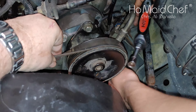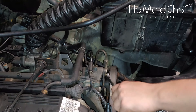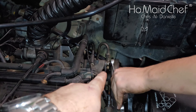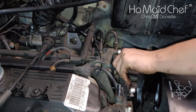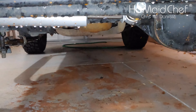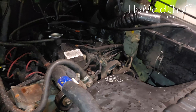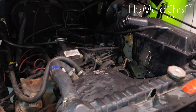We can always tighten it some more if it squeaks a little bit — you don't want to over-tighten your belt because it puts strain on the bearings on all your components. The last thing before we put water in is to tighten the front bolt — we left that loose so we could tighten the belt — and there's one on the back as well. Once they're tight we'll put water in and see what's leaking. We pulled it up to temperature — it's full of water right now and there's no leaking. Everything seemed to do just fine. No leaking, and we pulled this up to 210 degrees where the thermostat sits.